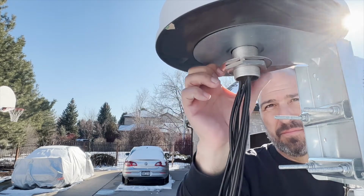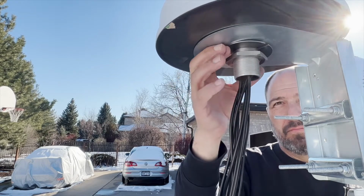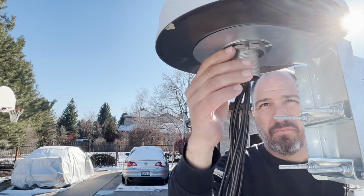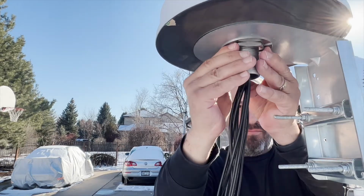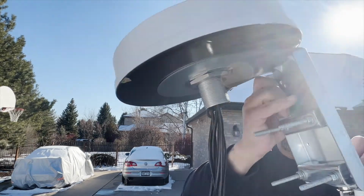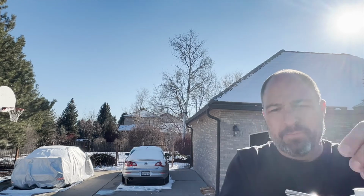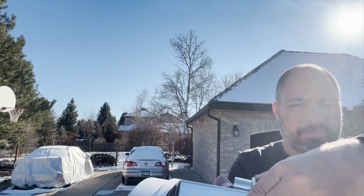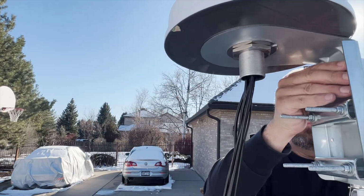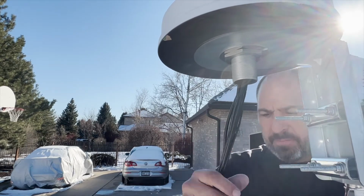In the video, you can see I have a flat washer and a bolt, but there should also be a big lock washer that goes between the two. I'm in the process of moving, so I probably misplaced the lock washer somewhere, and I'll definitely have to get a new one. If the flat washer is any indication, I may have to call Parsec directly in order to get a lock washer this big. Regardless, be sure to use that lock washer in your installation, or this whole thing could loosen over time. Use a pair of large jaw pliers to tighten the bolt until the lock washer is flat. Be sure not to over-tighten.